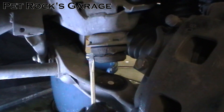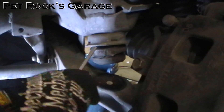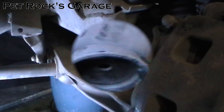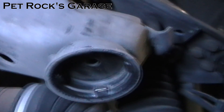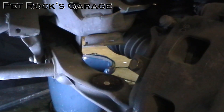So you just take a screwdriver, jam it up in the side pocket and just start prying it down. The bump stop is held in by these little pins right here, so it's just a press fit. There's no screws involved, nothing at all. It's actually quite simple. Install is just as simple, although it's made a little bit easier if you add a little bit of silicone lube.